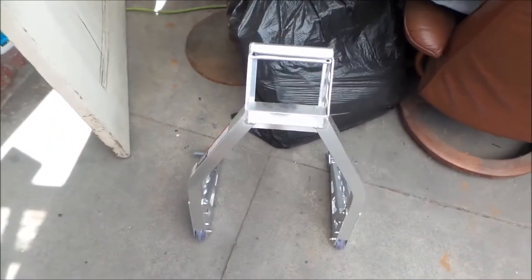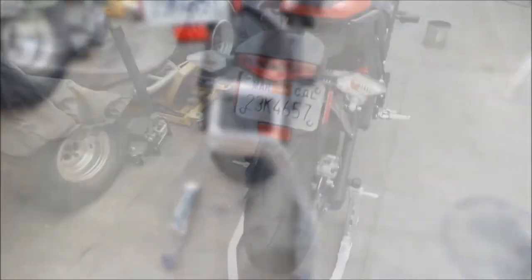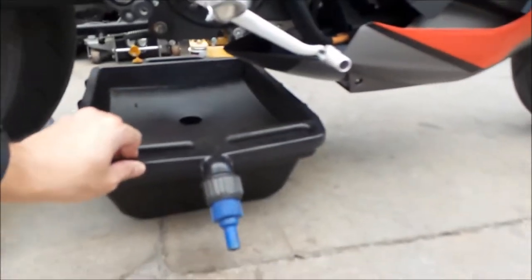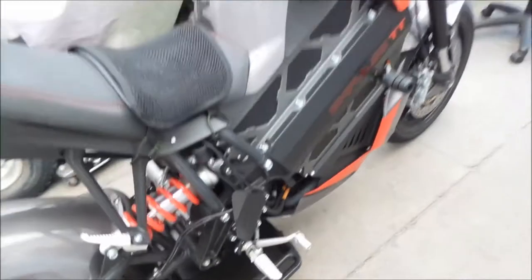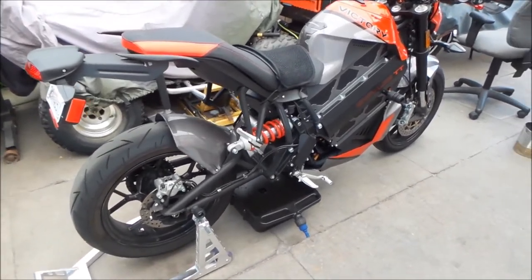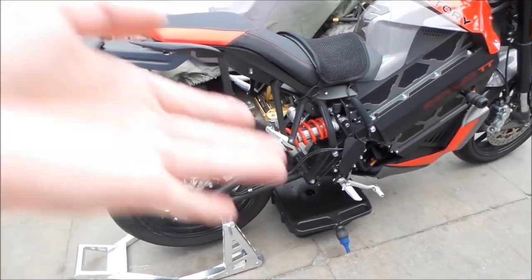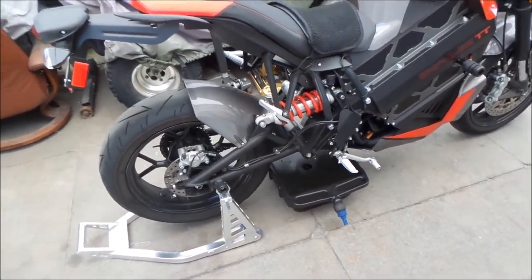First I'm going to put it on the rear stand. Okay, there it is on the rear stand. Let's make sure the handlebars are straight so it's not crooked. Then just go ahead and get a drain pan of some sort to drain your oil into. Also, in the manual it says to ride the bike for five to ten minutes before you change the oil. I just got back from a ride so that's why I'm changing it right now. The reason you change it after riding is so the oil is warm — it flows out smoother and takes more of the dirt and stuff out with it.